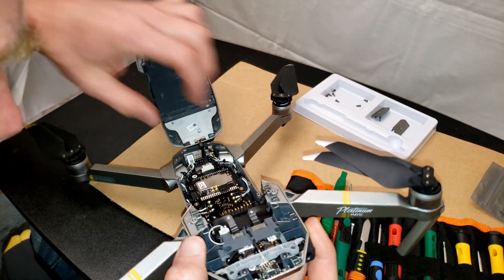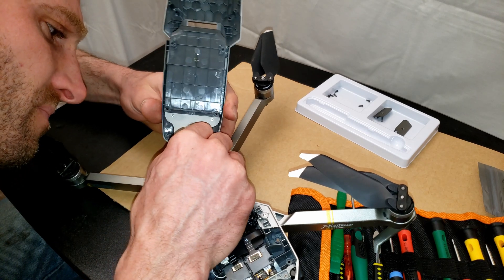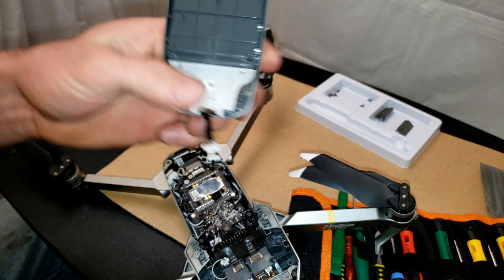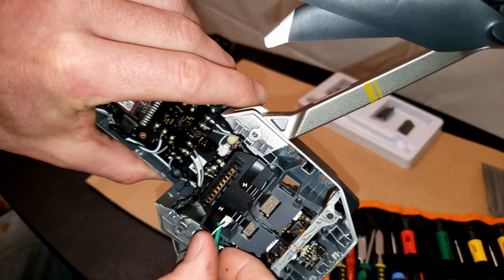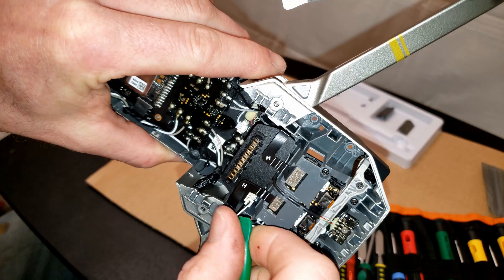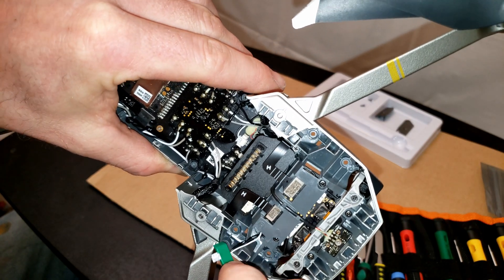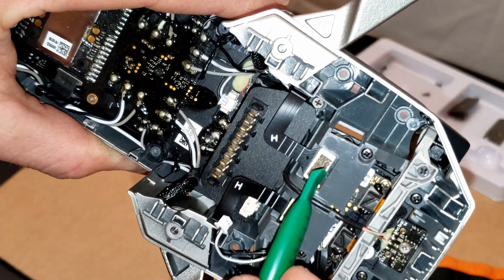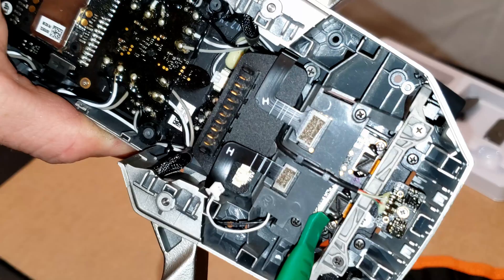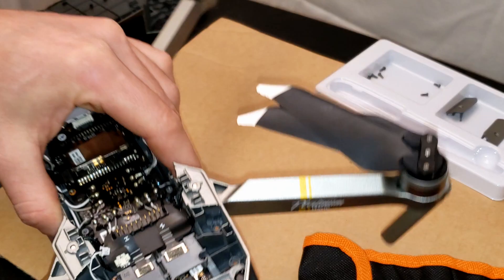On the back here, you do have one small cable — you just pull that straight out. Disconnect that. For your gimbal, you have five cables you've got to remove. You have this first little guy right here — pull that up with some pliers on the plastic if you don't want to pull the wires out of it. And then this ribbon, this ribbon, and these two little guys, which actually look like they have a dab of silicone on them.